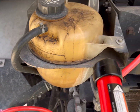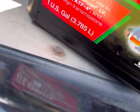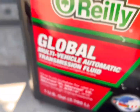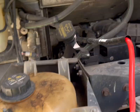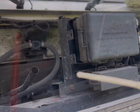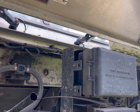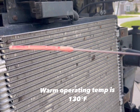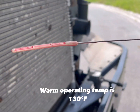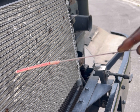This will be the last time I use this pump because I got an electric one. I'm using O'Reilly's transmission fluid — it takes the Mercon, which comes in an orange bottle, but this is what I got for now. I'm filling it up and going to check it. I filled it up with so far just one gallon, but I'm going to warm it up and get it up to temperature so I can really see the level. This is what it looks like right now.